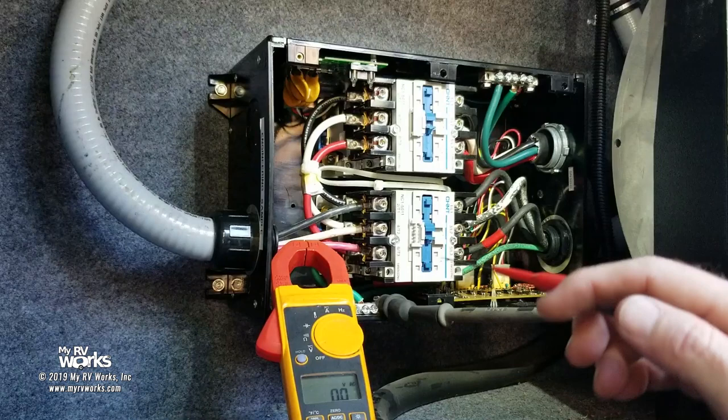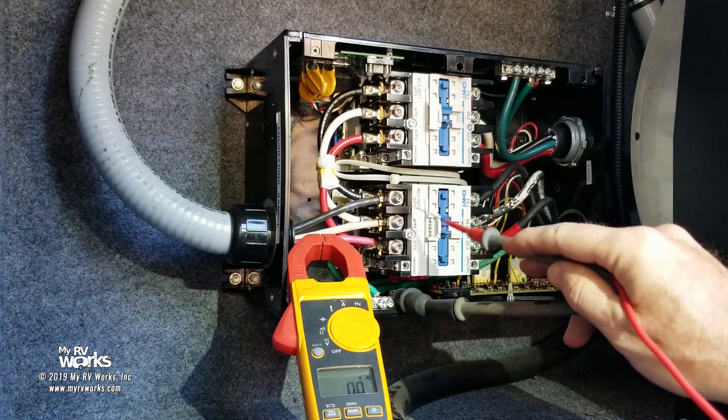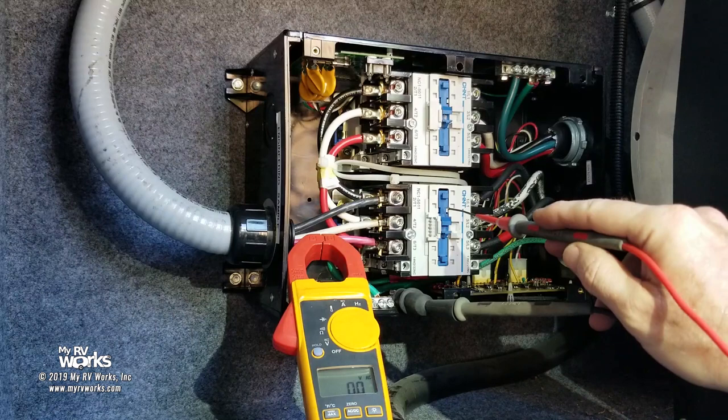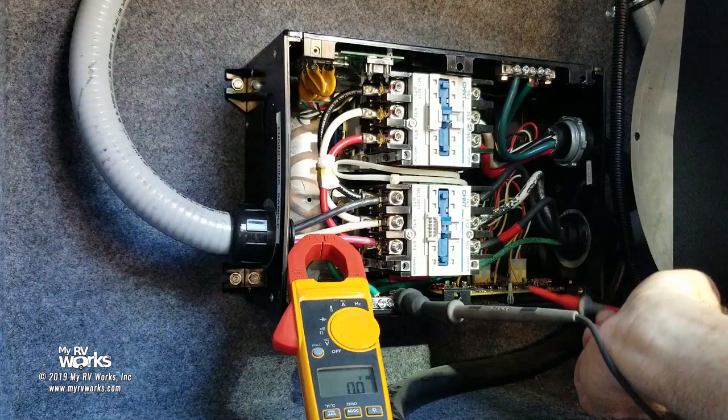So here's what I'm gonna troubleshoot. There is what's called a coil voltage on these contactors. And the coil voltage, so there's two parts. These are like three-phase contactors. You got L1, L2, L3, but we're using them in a single phase for the three wires. So that's great, but there's a power side of this and there's a control side of this. The control side is what's gonna create an electromagnet and suck that blue thing inside, okay? Basically, this is a big magnet. When you hit it with 120 volts, it's gonna suck it in. Call it sealed in.